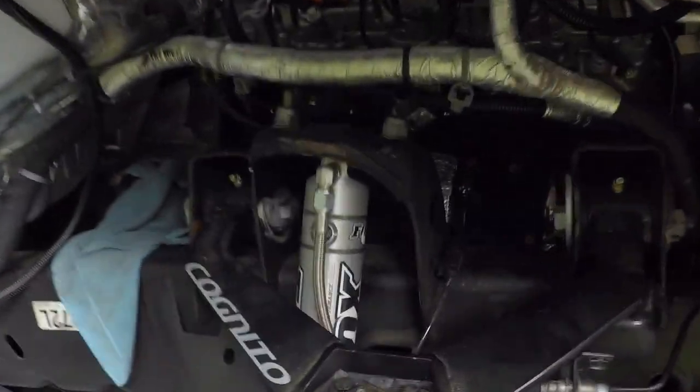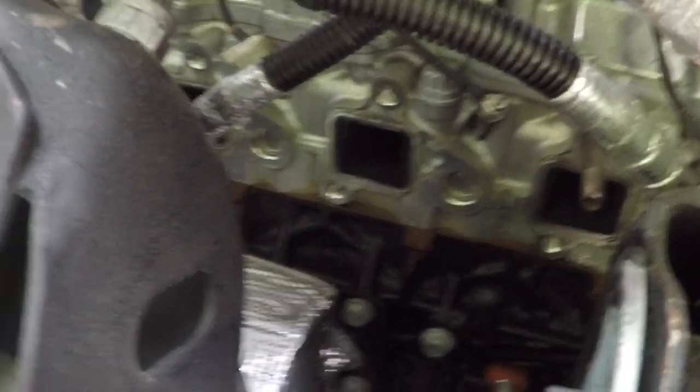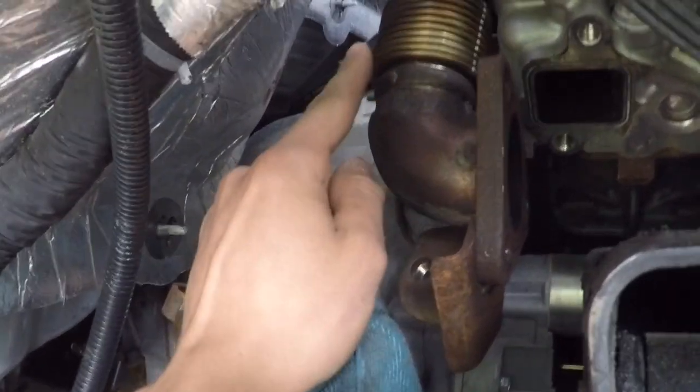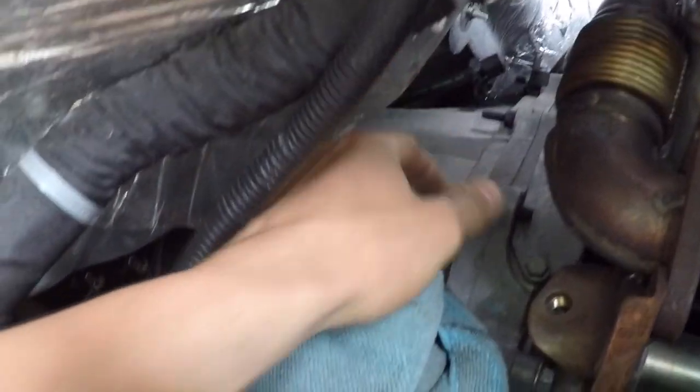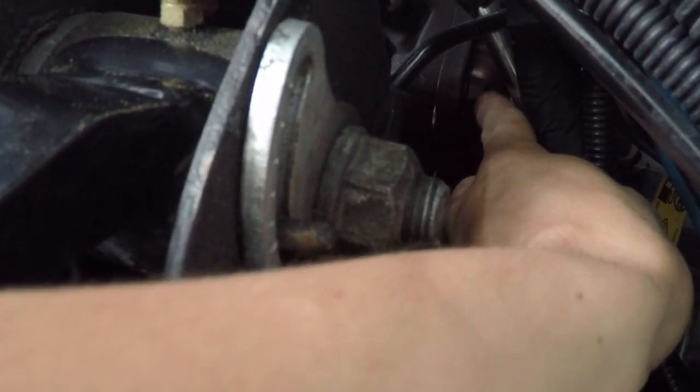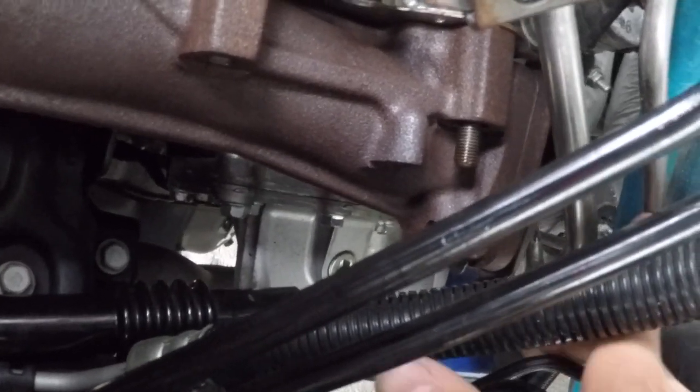Let's go check out all the parts I've taken off so far. I already did start — I kind of jumped the gun and realized I wasn't even recording yet. Over here I already got one of the manifolds off. As you can see, all the ports here — that manifold connected to the up pipe. This up pipe sends air up here back to the turbo, and from there it comes back down through the down pipe, then goes to the exhaust. The manifold right here is all unbolted. The up pipe connects with three bolts — one here, one on the bottom, and one way in the back that I can barely reach.